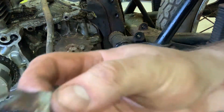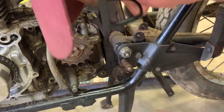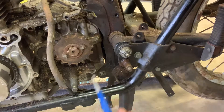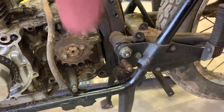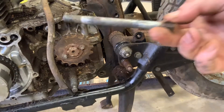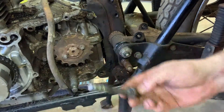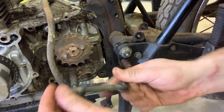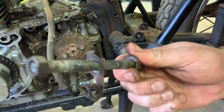Notice we've got our holder for the starter cable and one nut. There is a washer basically rusted right to the frame. I'm going to use my punch and just give this a nice tap, and that bolt on the other side actually just flew right out. Here it is — big long bolt. That is your rear. I'm going to take the washer and the starter cable stay, put these together, and there is the number one bolt.